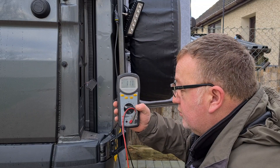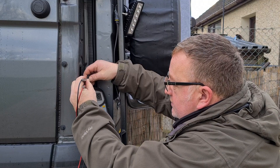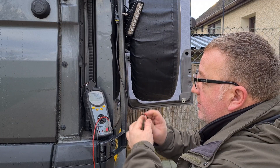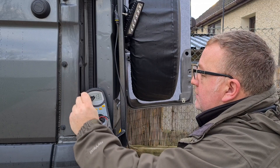We've got the multimeter set to DC. Let's see — we've got the van set up in reverse and what have we got there — 11.75 volts. Good. We'll put the light there and see if it comes on. We'll just drop the probes in the back of the connector and see how we get on.